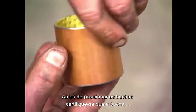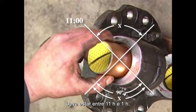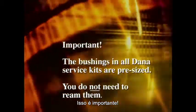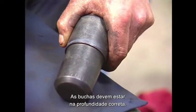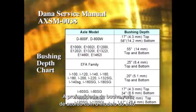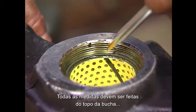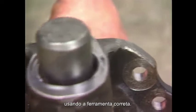We'll now install the new bushings. Before driving the bushings into position, make certain the seam of the bushing is oriented properly — it must be between the 11 o'clock and 1 o'clock or between the 5 o'clock and 7 o'clock positions. This ensures the seam is not located in a highly loaded area. The bushings in all Dana service kits are pre-sized; you do not need to ream them. The bushings must also be driven to the proper depth — a line can be made on the driver to indicate correct depth. Check the Dana Service Manual AXSM0038 for the depth chart. All measurements should be taken from the top of the bushing to the top of the knuckle surface. Drive the bushing into the knuckle to the proper depth using the correct driver.